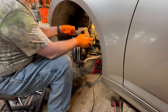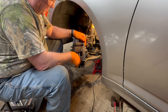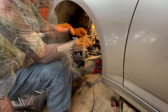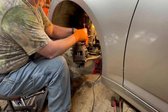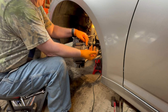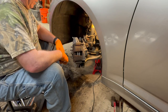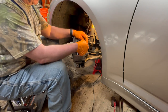I'm going to grab the caliper and swing it into place. By the way, I compressed the piston — I don't remember if I did that on camera or not. A ratchet wrench works well for tightening the caliper. So it's snug. There are probably torque specs for it — I probably should have gone back and double-checked.